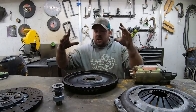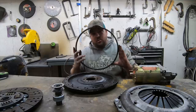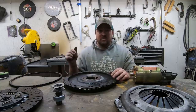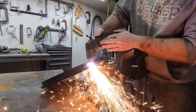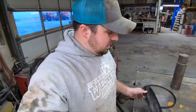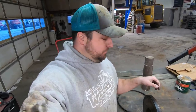When metal cools it shrinks, and it sticks on there pretty good. So if you ever have a problem with the ring gear going bad, you can just replace the ring gear instead of buying the whole flywheel. For those wondering how far you put the ring gear on — there's a little machined groove right here, a small lip, so it can't go on any further than it needs to. All I've got to do is heat it up and tap it right on.